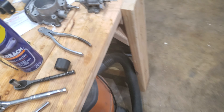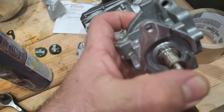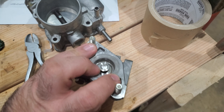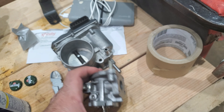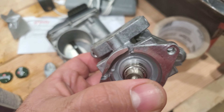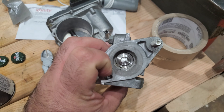Other pieces too — this EGR assembly was completely stuck and I left it inside the gasoline as well. I put a little tiny screw in here so it kind of stayed open. I didn't do a power wash on this because it has some stuff on it, so I used brake cleaner to clean it out. That turned out pretty good too, and then I WD-40'd it.